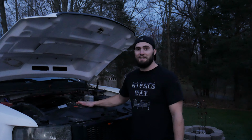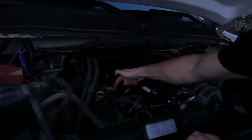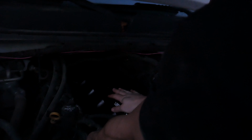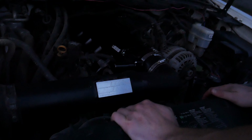All right, everything's back together, bolted up, tightened on, plugged in. So I'm gonna come in here. Got all of our injectors hooked back up. Got this plugged back in, map sensor in the rear plugged in. I do have to get that back on. That's simple enough. Intake horn back on, so everything else is good. So let's go prime the fuel system.